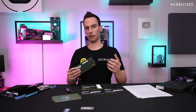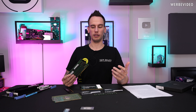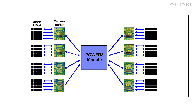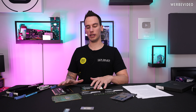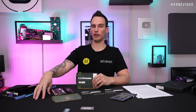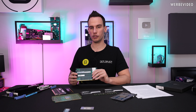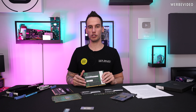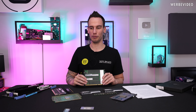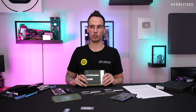Now that the Centaur chip also acts as a memory buffer and memory controller, it also makes the server upgradeable to some regard. Because the memory controller sitting in the Power 8 CPU is connected to these chips, which are theoretically also a memory controller. Which means that if you upgrade these chips, you could theoretically use DDR4 DIMMs with a server which was only meant and built for DDR3. IBM Power 9 and Power 10 servers use different DIMMs — something completely new — and a server company from Germany contacted me, working with Power 9 and 10 on a daily basis, so we will stop by and look at everything they have in the near future.